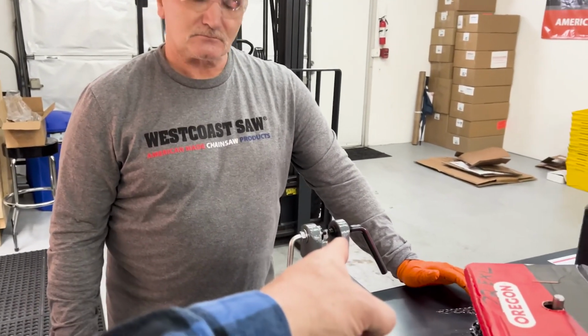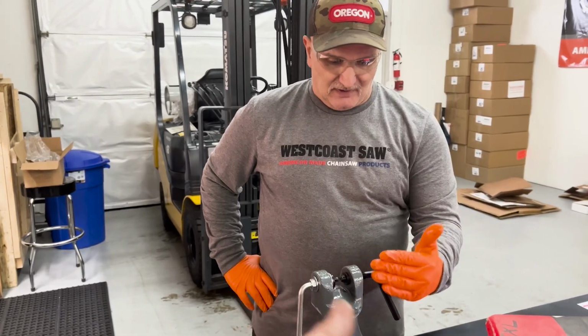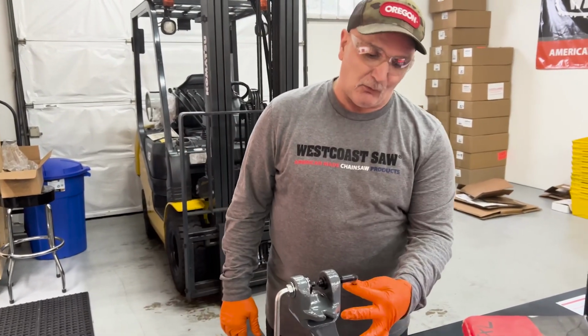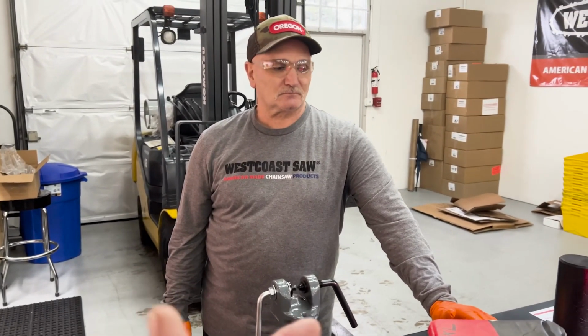And what I've learned is you have to go further on a 72? 72, which would be a 50 gauge, is about 6 o'clock on how ours is set up. Yep. But if we're at 75, which is a 63 gauge, it's about 4 to 4:30. Okay. So each chain size, it depends. Yep. You can't go to 6 o'clock on every single chain. Nope. Because then you'll get too tight. Yep. Now, show them when the chain gets too tight.